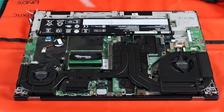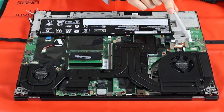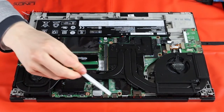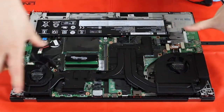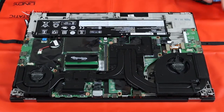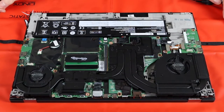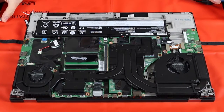The battery connects into the motherboard, and you can see the connector for the daughterboard — which surprisingly also connects into the fan to power it. The graphic module sits on top of the motherboard, and once the fan is released, you can move it up and remove it. Because the graphics are modular, Lenovo has the luxury of offering a wider range of specifications with the same hardware.